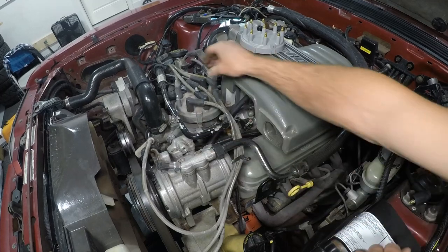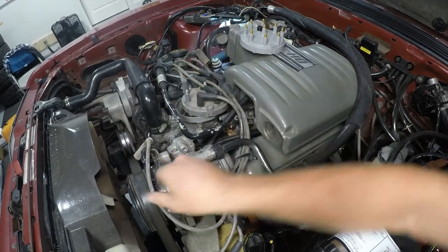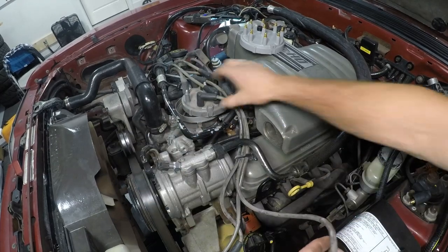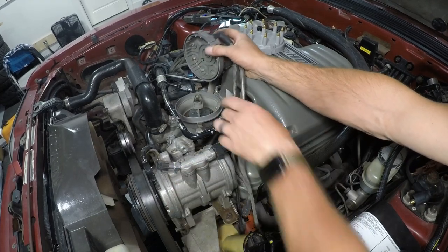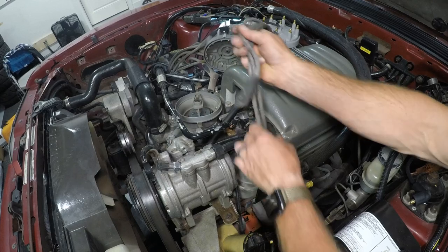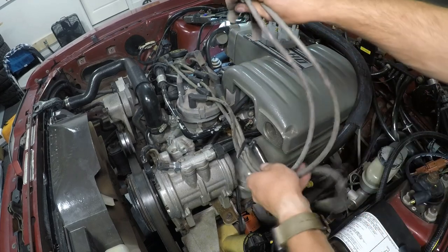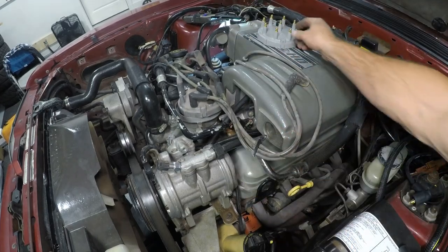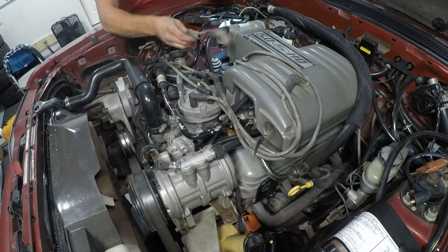New plugs are in. Now I'm going to pull the cap and plug wires off the distributor. I pull all the plug wires and cap off while they're still intact to the cap, so I've got a little bit of a template for when I go to rig up my new cap and wires. Essentially I use the old cap and wires as a schematic — you can see some wires are a little bit longer than others that need to reach the back of the head. This way you have a side-by-side comparison for how the new cap and wires will go.